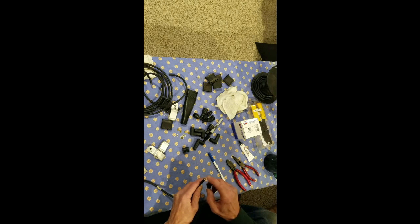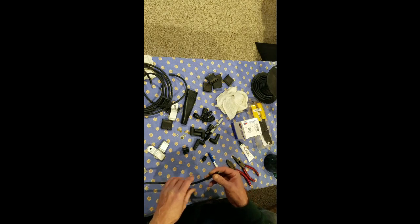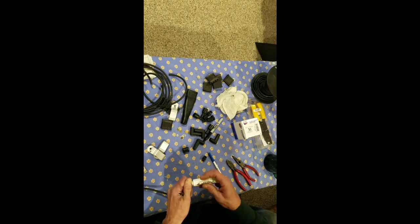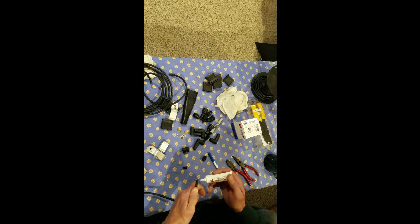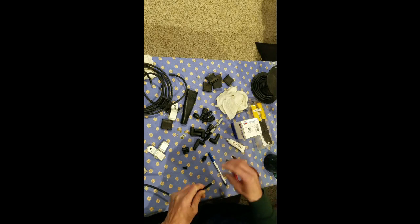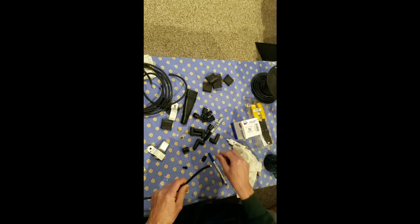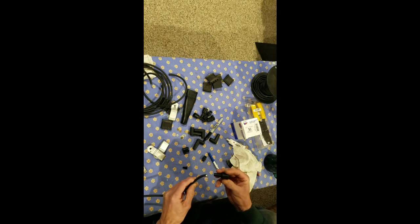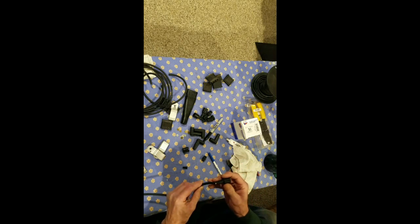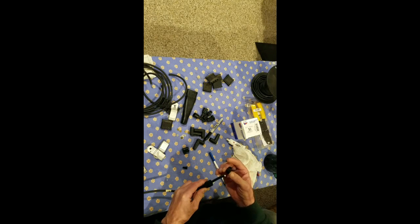When I put the brass pieces on the end, they go down inside the distributor, and with the screw ends you've got to have that type. If you've got the plug-in type, I think Albers sells them so you can use the regular modern type of plug on the end of the wire, but these you've got to have the wire to crimp around the little brass contacts at the end. I use some dielectric silicone - it's a lubricant for electronic ignition, not a real conductive substance, but it makes getting the connector on there a lot easier. Make sure you get the threaded end towards what's going to be the distributor cap.